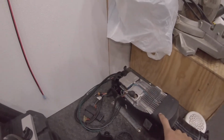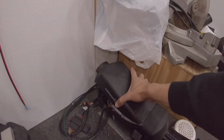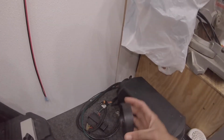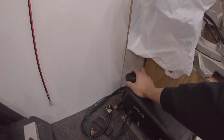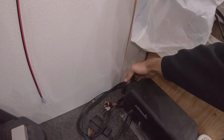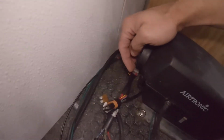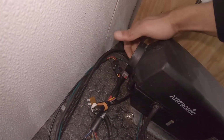But I'm just going to go ahead and start taking stuff apart, which you can see I already started. I already took the cover off. If you do have a diesel heater, this applies to the D2 and D4. This cover goes on top like so. And then there's a little air vent flap for the exhaust fan, or the intake fan anyway. There's a little cover that goes over the backside like that. So you'll take this off first, and then there's some clips on the back side. You just undo the clips and this will slide off,